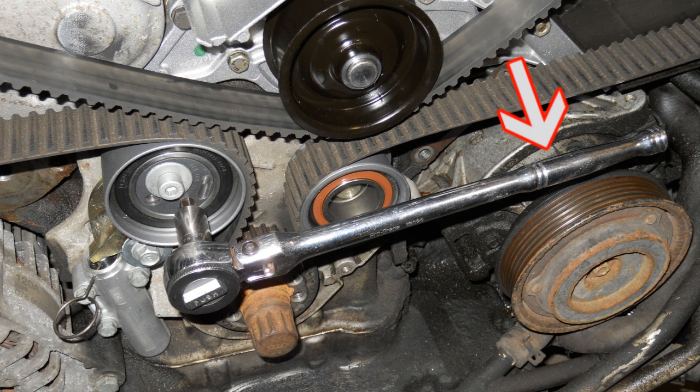Failure to compress the hydraulic tensioner damper in a very slow manner can result in the incorrect transfer of fluid within the hydraulic tensioner damper, causing it to lose its ability to tension the timing belt. Do not scratch or scar the shaft of the hydraulic damper, as this can damage the hydraulic damper. Failure to compress the hydraulic damper slowly can cause irreversible damage to the hydraulic damper.